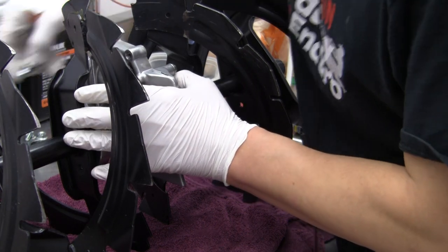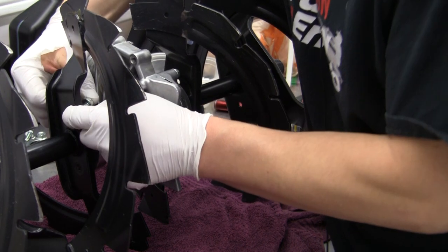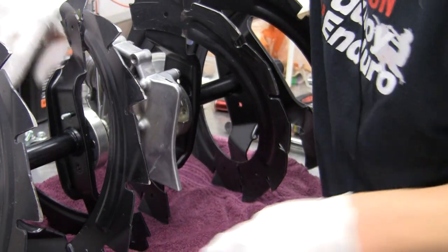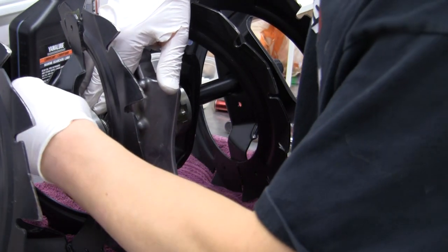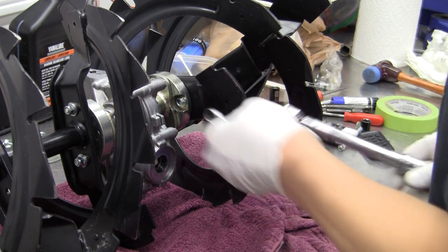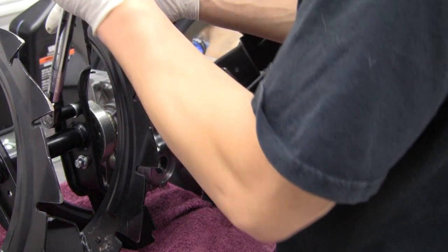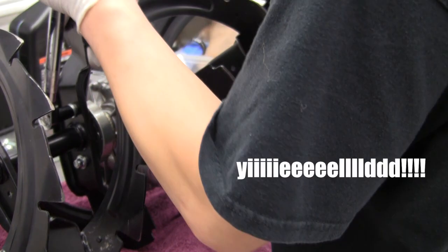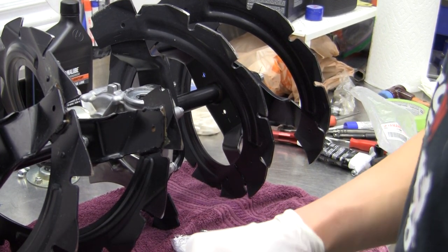With that in place we can now get the shear bolts in there — these shear bolts go from inside. Get the gearbox back up, there's our bolts, then we put the nuts and the washers. Our final torque value is 89 inch-pounds. Ouch! Ouch! Ouch! Ouch! Some of the nuts became fatigued — I think maybe from being torqued too many times. I did that previous maintenance video and now I'm doing this.